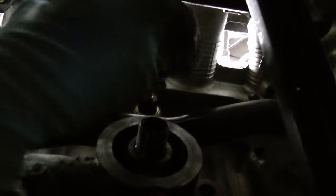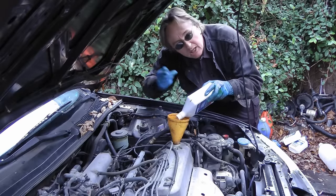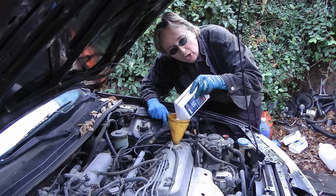Then get the wire and plug it back on nice and tight. And of course remember to put the oil filter back on and fill it up with oil before you start it, because you don't want to ruin your engine running it low on oil.